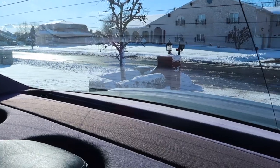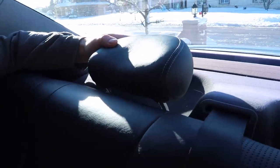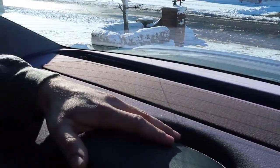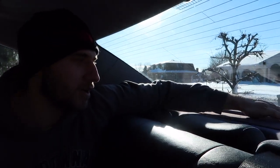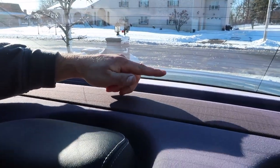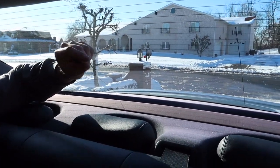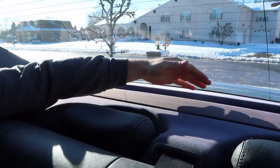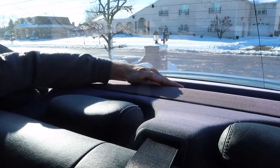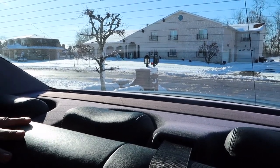Now we're gonna go ahead and get the windows tinted. When we were looking at other videos, everybody said you gotta take apart the whole thing, take out the rear seats, take out the trunk headrests — they said the headrests were a pain to do. We said no, we're not doing all that. Literally all we did was take this back shelf piece off, lift it up, take that one screw out. We used channel locks because we only had a small drill bit for the Torx — we put it in the channel locks for leverage and did quarter turns to get the screw out. Once it's out, just lift the arms right off the gear and they fold right in. It'll only take a couple minutes.